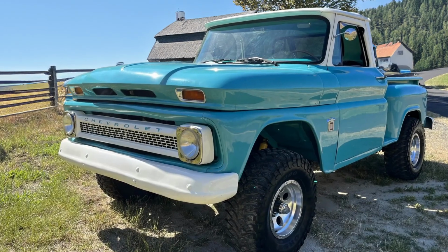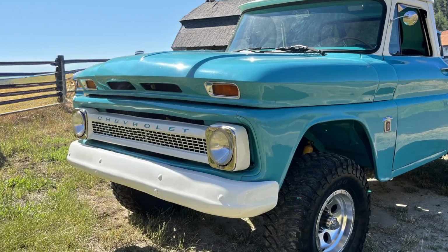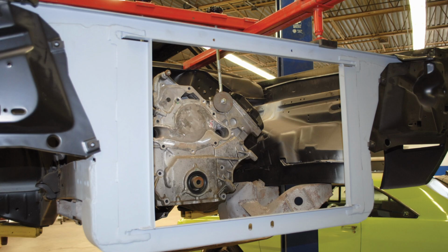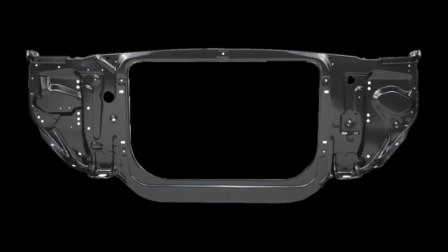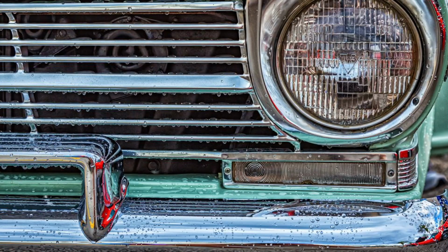Newly painted fenders can insulate turn signals and brake lights, preventing proper function. Newly painted or powder-coated hood hinges can prevent the grounding of hood-mounted lighting. Painting the radiator core supports can insulate that structure. Items that ground through the core support will fail to function, such as headlights, park lights, front turn signals, and electric cooling fans.